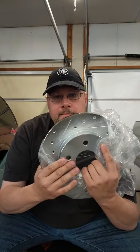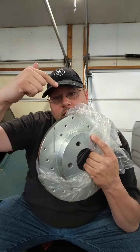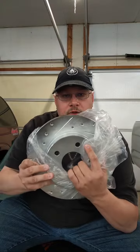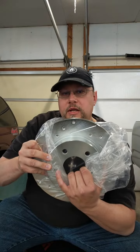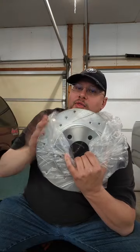So what does that look like? If the rotor is turning this way, the heat is going to go this way — it's going to come out of the vents. If it looks like it's cutting in the direction that the wheel goes at highway speed, then it's going to push that heat into the rotor. That's what can damage rotors and cause brake fade quickly.